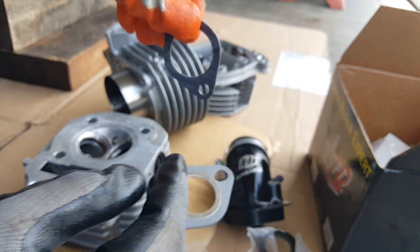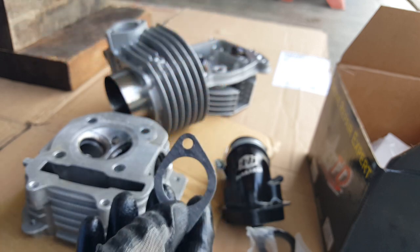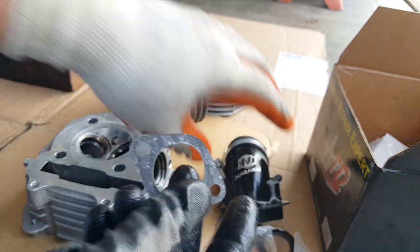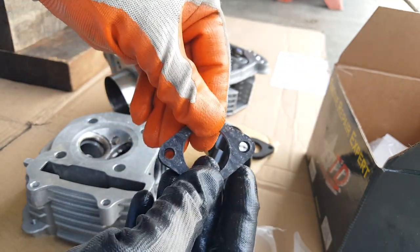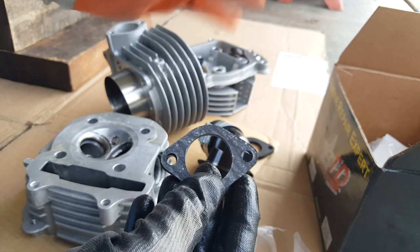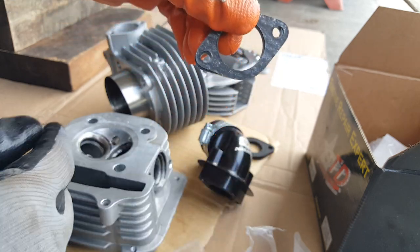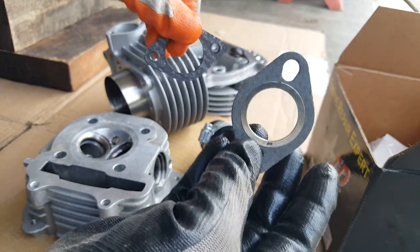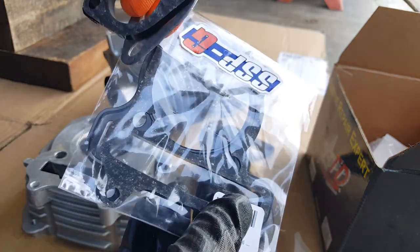And they do have the paper gasket in here, as well as the timing cover gasket. Remember again, our intake manifold gasket was the same as our cam chain tensioner gasket. This one's for the exhaust gasket — we'll probably use this one brand new instead of the NCY one. We're going to keep the exhaust gasket dry as well — meaning no copper spray. We're also keeping our base gasket dry. The only thing we're going to spray is the metal cylinder head gasket.